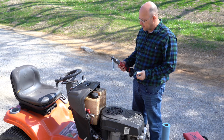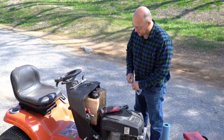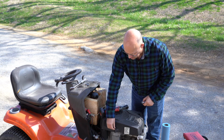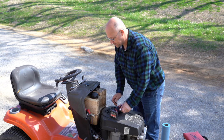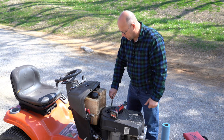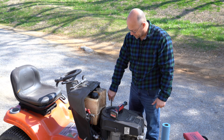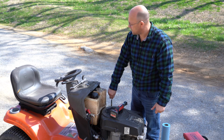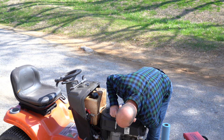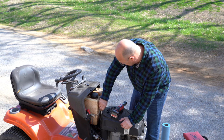So when you're tightening these screws, you don't want to start right out with one of these. You want to just drop them in the spots where they go. And then you want to spin it backwards, and you'll feel it drop into the threads. There it goes. It'll make a little click sound. And then you can start it. Let's see if I can get close enough so you can hear it. There it goes. And by doing this, you won't strip out that aluminum.